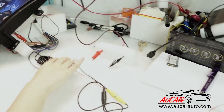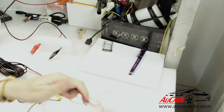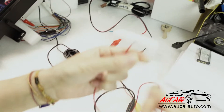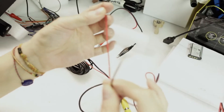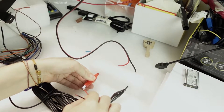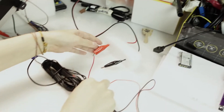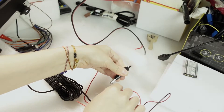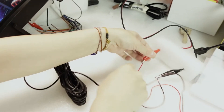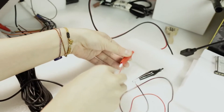Now let's finish off the other side — the camera wire. You will find black for ground and red for 12 volts. Usually you are going to get the power from the tail lights. You might notice there is another red wire here, so you connect them together.